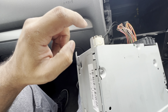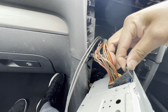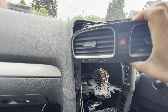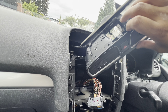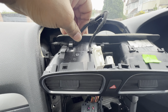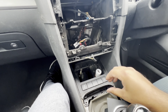For the connectors: pull this tab up and pull the cable out. For the other one, pinch the tab and pull it up and away. Next, remove the heater vents — there's a white cable plug behind them you need to disconnect. That cable runs from there and clips into the box, so take that clip off and undo it, then disconnect it.